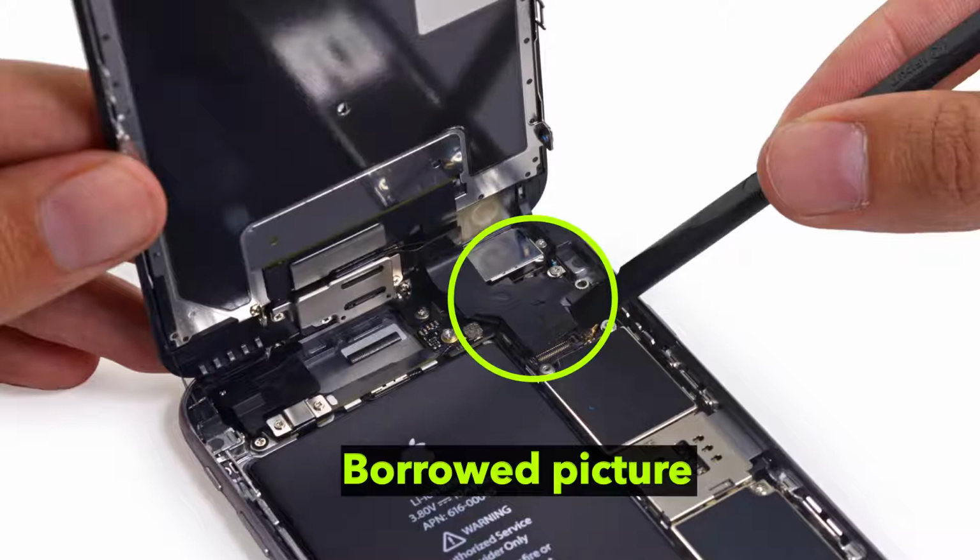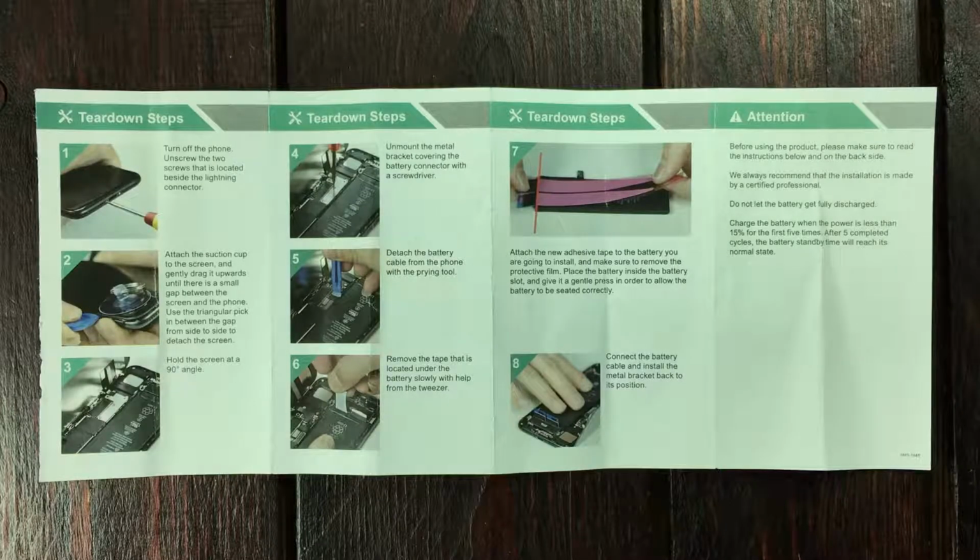So I removed that plate holding the 3 connectors going from the circuit board to the screen. And once I did that, I popped off the connectors, which are really tiny and feel really brittle. It's not fun at all doing this replacement, but you get the screen off there. When you have it off, suddenly you're free to work with the chassis and the circuit board. Now, from this point on, all you have to do is remove the battery.